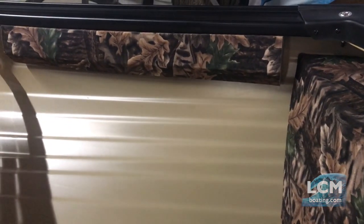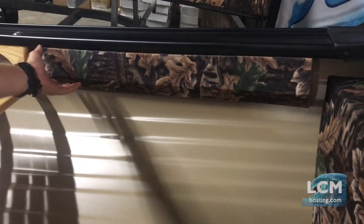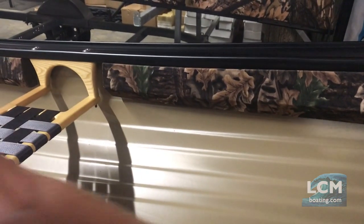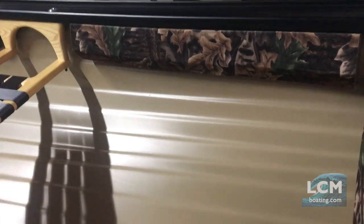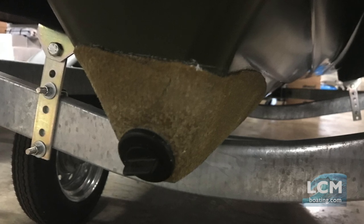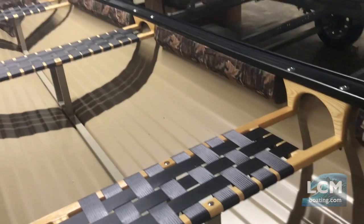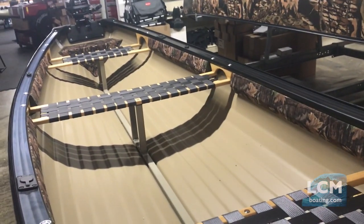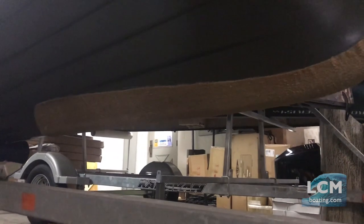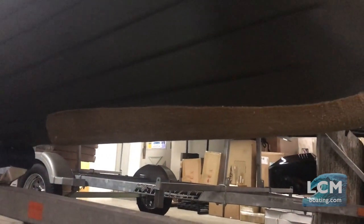The Rangeleys are set up with foam flotation inside. You'll see they use foam flotation up against the gunnels, camo wrapped, and there is foam flotation in the bow and stern as well. There is a drain plug at the back so you can rinse and clean this boat. Underneath the bow and stern there are Kevlar skid plates that come standard, so this boat is really made to bring right into the shoreline into the sand — you can pick up the nose and drag it without worry.